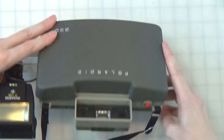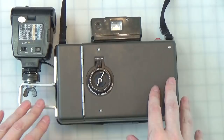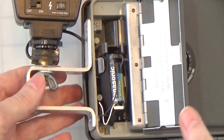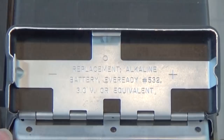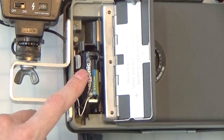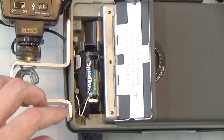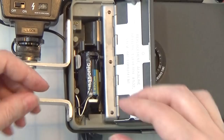When I got this camera, the first thing I had to do was get the power going. There's a little battery compartment which opens here. Originally it says inside the cover: replacement alkaline battery, EverReady number 532, 3.0 volts or equivalent. The original cell had about the same diameter as modern 3-volt lithium batteries, but it was much longer — twice as long — and on the ends it had snap tabs, very much like a 9-volt battery. They were color-coded black and white, negative and positive. They snapped onto the ends of the battery, and the battery snapped into two plastic clips inside. To convert it to a modern 3.0-volt lithium battery, I had to create a little sling made out of elastic.